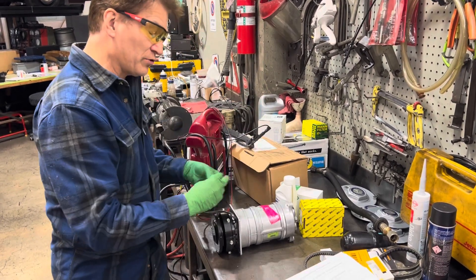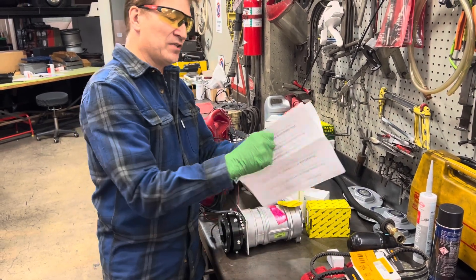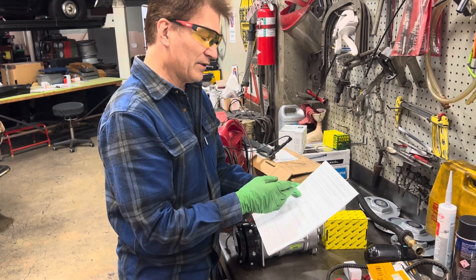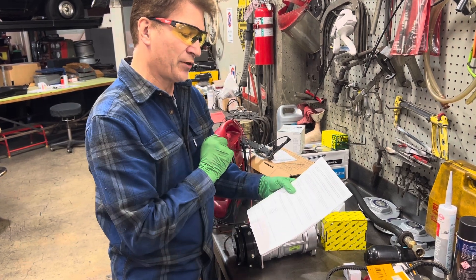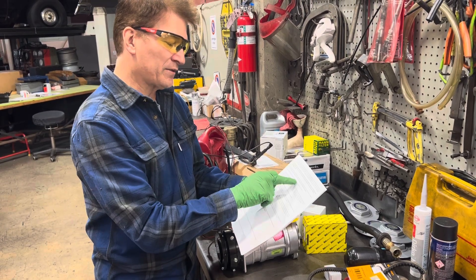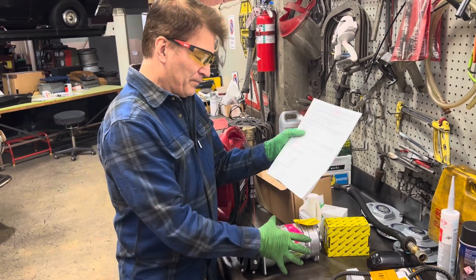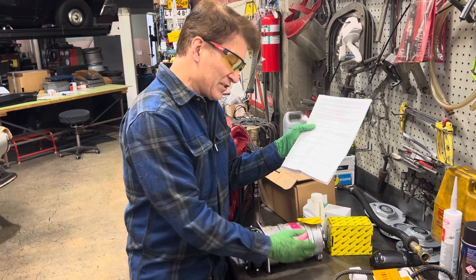There's another little confusion with using colors. Some guys don't like to read the tags, but if they pick up the instructions and briefly, without paying specific attention, they talk about colors. This compressor comes with color-coded labels on the ports. The instructions indicate whether it should be drained or installed or not. In all cases, add the correct amount and type of lubricant — the viscosity and the amount. These compressors held six ounces in the belly, and that is not on here anymore.